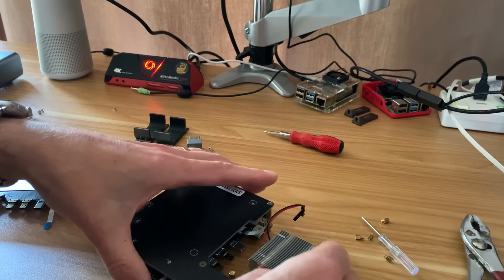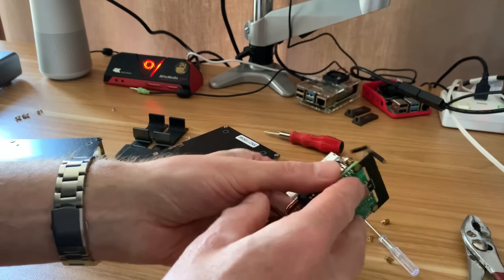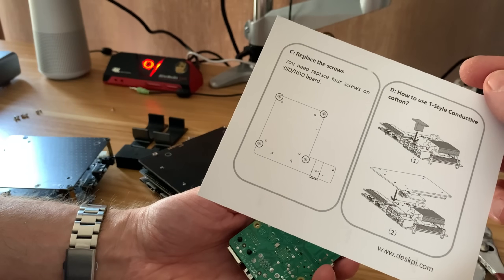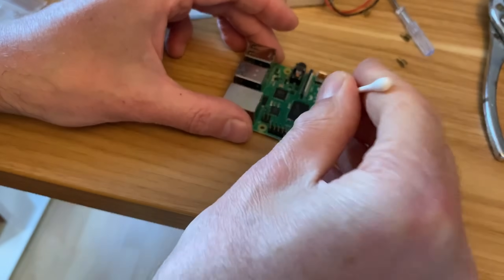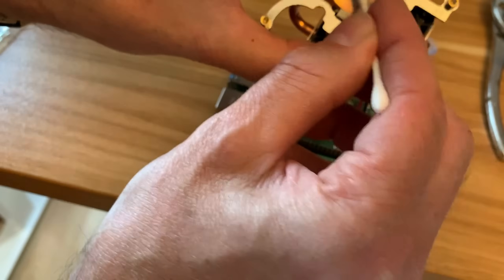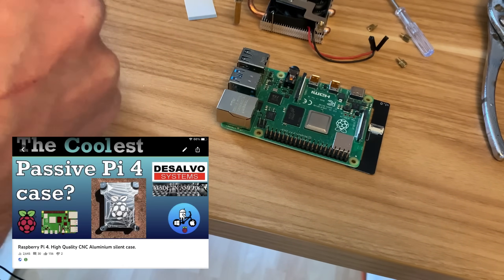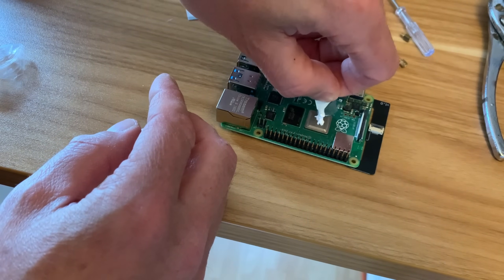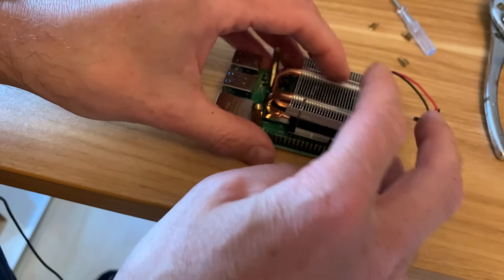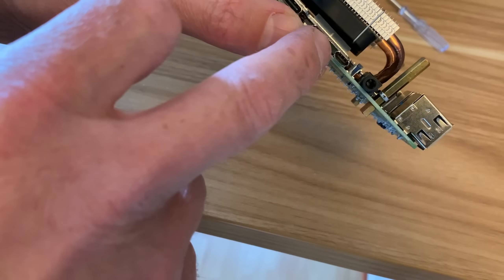The board is going to go all the way up there. I could go in underneath and put this back on - I probably didn't need to take these off in the first place anyway. These are literally the instructions I've got, just that little bit. I'm going to put some more thermal paste on, so let's give that a clean off. I've cleaned off the thermal paste from both surfaces. I can feel that it's touching the thermal paste - they've done these really tight, and looking through I can see it's nice and snug on the CPU.